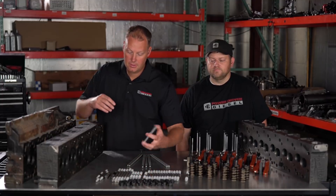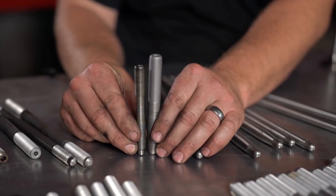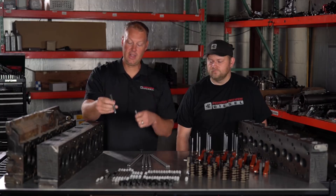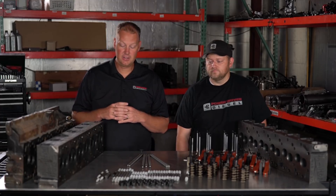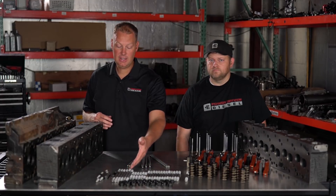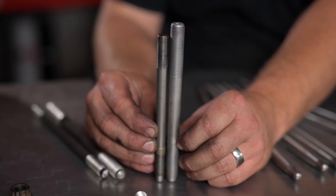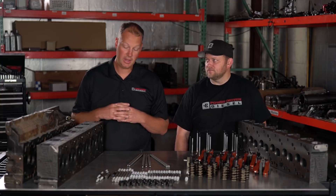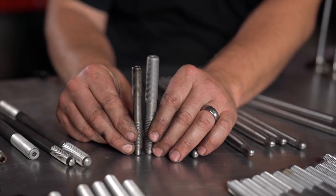You'll notice they're quite a bit taller. This is a standard head stud, and this is one of ours made for the Warhead. You can see how much taller the one is than the other — you've got to have that, otherwise you're not going to be able to get a nut on it. Another thing with the head studs is they're quite a bit bigger. Our head studs are all tapped for a 14mm in the block, and then from there we come up to 9/16ths. The factory is 12mm both in the head and in the block. You can really see how much thicker the 9/16ths stud is compared to the 12mm.